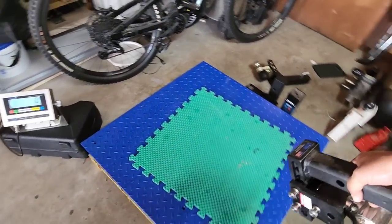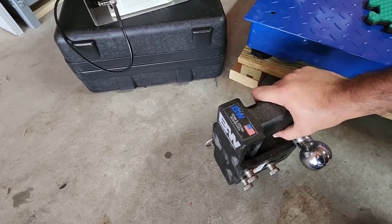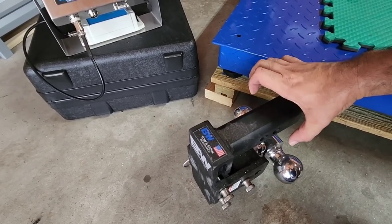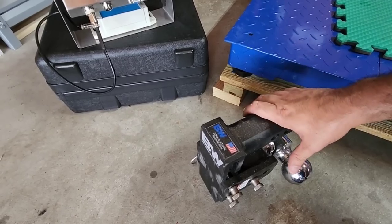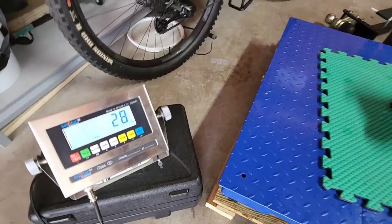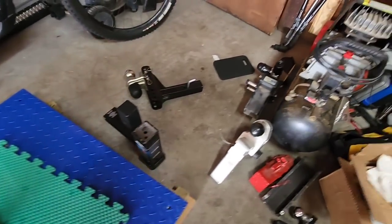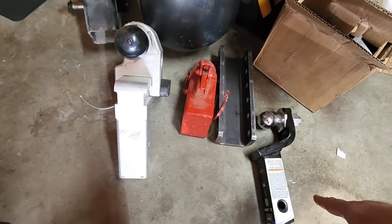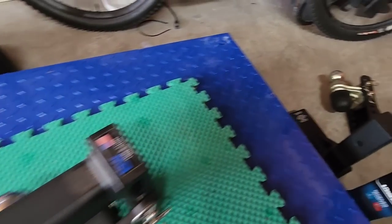Next I have a B&W Tow & Stow tri-ball hitch with a 2-inch shank. A 2-inch shank is the smallest shank size offered for the B&W Tow & Stow — they also have 2.5 and 3-inch. Ford Super Duty and some other trucks can take a 3-inch. What do you think it weighs? 28 pounds. So this assembly right here weighs a little more than the coupler and adapter combined, which was 22 pounds. This entire tri-ball assembly is 28 pounds by itself — same as just the steel shank.